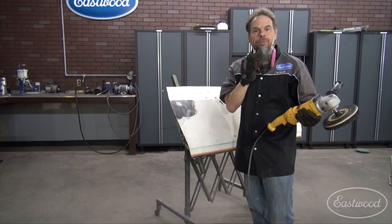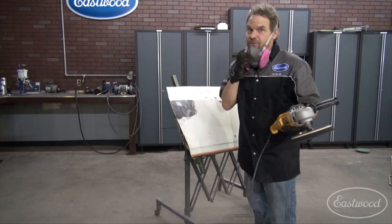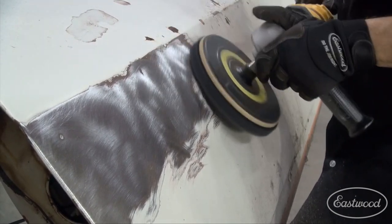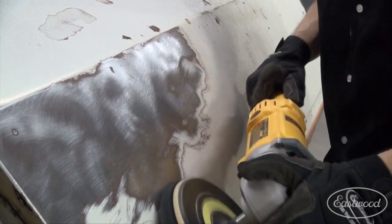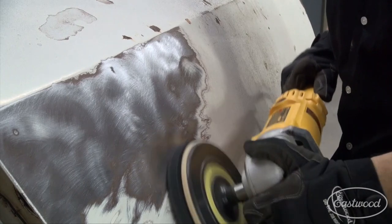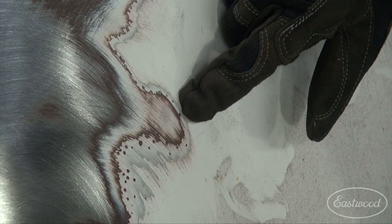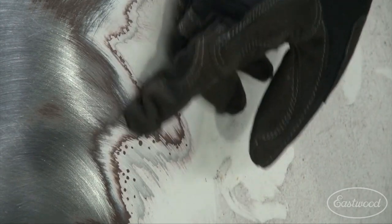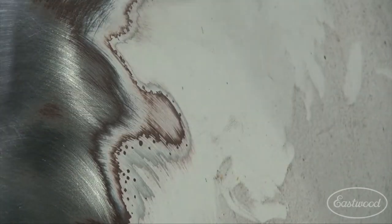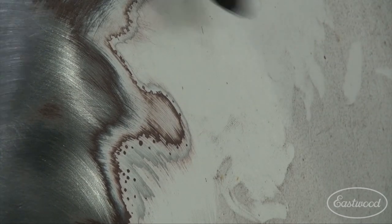I'm going to start off at a low RPM - probably about 600 to 1000 RPM - and just see what this guy does. I think it's going to do pretty good. Here's something kind of cool. What this looks like to me is that there's clear coat, base color, some sort of primer. Right here we've got the original paint, the original primer or E-DIP coat, and then there's steel. So this, in a kind of a roundabout way, tells me that this car's had two paint jobs on it. And that's kind of what we thought - it's kind of what we found all over the car - but I'm doing pretty good on stripping though.